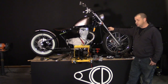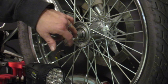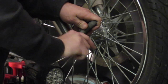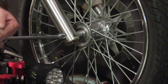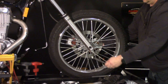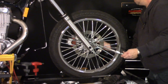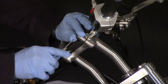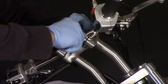We still need to add the suspension lowering kit — it'll drop this down two inches exactly. But first we have to take off the wheel and then drop the forks out. We need to pull this cinch bolt out of here. In order to get those fork caps out we first need to remove these handlebars, which have these little chrome covers over the screws.